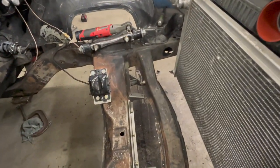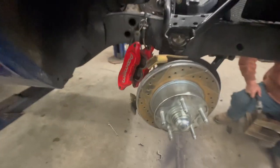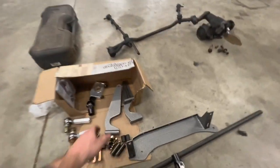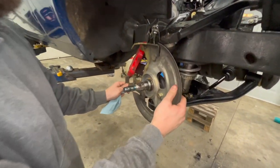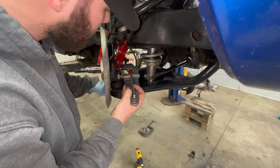Man that looks fancy in there. The rack and pinion is hitting right where those marks are. We're also taking the caliper and the rotor off so we can get to the tie rod mount, because we gotta take this factory one off. These are the new tie rod mounts that will bolt to the back of that spindle. All we gotta do is take these two bolts loose and there's nuts on the back side - it goes like that.